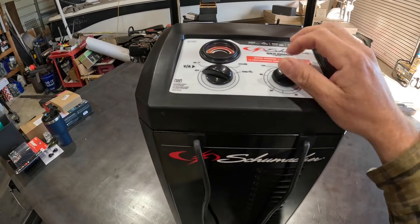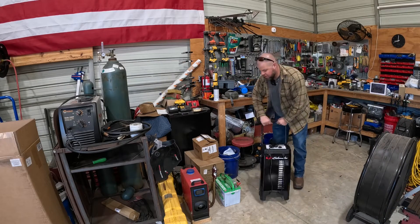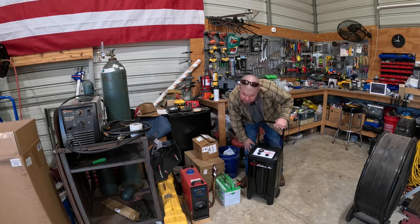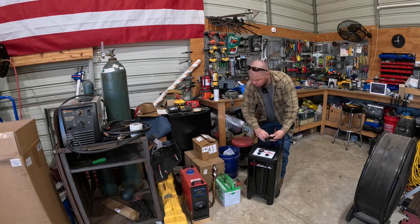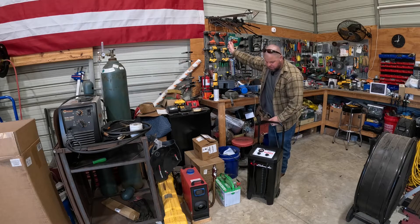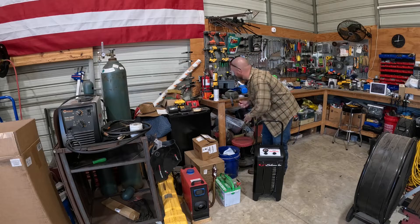If you're looking for an old school style manual charger, yes, they still make them — I was so excited to find this. Over here is where I've set my diesel heater up with a very old battery. It's about eight years old — a battery should never last that long. It still maintains 12 volts to run my diesel heater and fan, but when the glow plug kicks on, it pulls it down hard to 10 or 11 volts and the diesel heater kicks off. But that's only in the initial startup. This charger will allow me to maybe get a few more months to another year out of this very old battery.